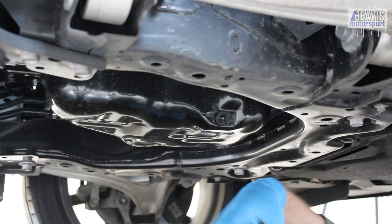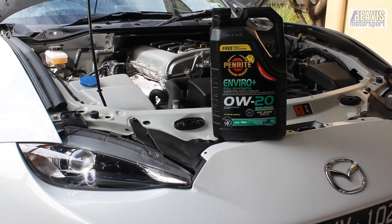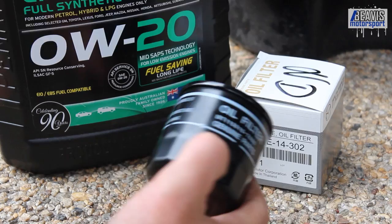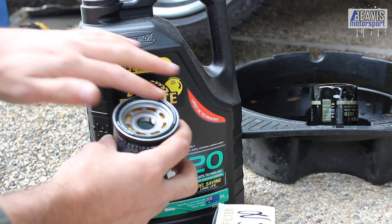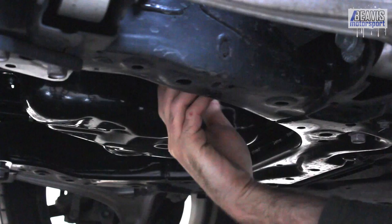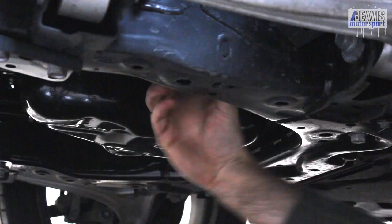With that off it's time to get the new filter on. However, there's one thing I wanted to add - this car uses a fairly thin 0W-20 oil, which is probably common for modern engines nowadays that are running higher compression with tighter tolerances; they need a thinner oil. I like to use this Penrite stuff - it's an Aussie company, so good for us to support our own. With regards to the oil filter, I've opted for a Mazda factory oil filter. The reason for that is apparently there's some special stuff going on inside that's particular to the Skyactiv motors, so I thought no point cheaping out on an eight dollar filter - might as well just buy a twenty dollar one. My recommendation is just go to Mazda and buy a factory oil filter. Interestingly, these filters come with the oil seal already lubed up with some Vaseline-type stuff, but like any oil filter - and it actually says it on the box - always add a bit of oil from the jug around the seal just to be safe.